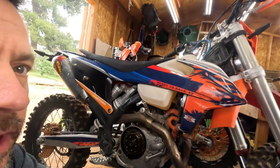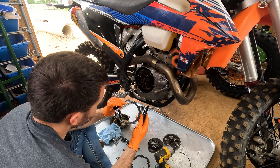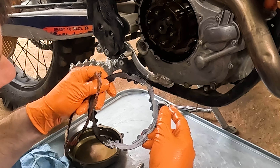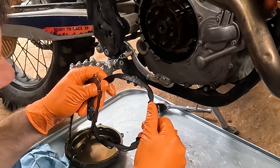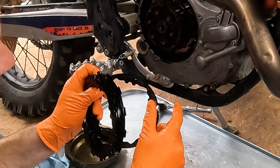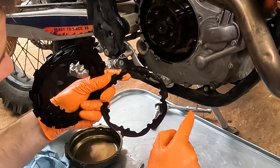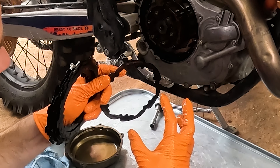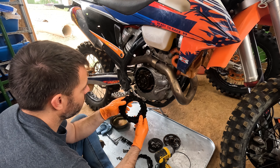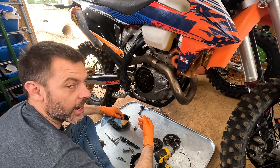There's a lot of wear in the steel plates — these clutch plates are just stuck together, that's why there's so much drag. See how there's a black part and then silver, which is the friction surface, and then another black edge? If I run my finger across the plates near the top of the stack they feel smooth, but in the middle of the stack I can definitely feel where the color changes — which tells me the friction material has actually cut a pattern into the steel plate. I think part of the drag is the plates are set into the steel just a tiny bit when the stack is compressed, which means these steel plates are worn out. I'm going to try the stock plates with the Recluse basket and hub and see how they compare.